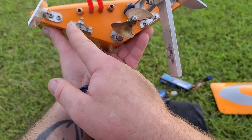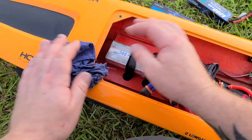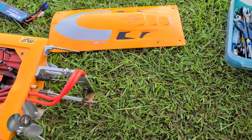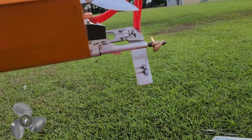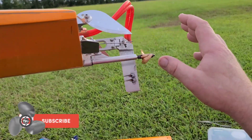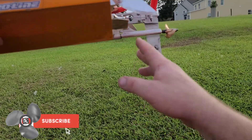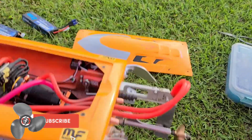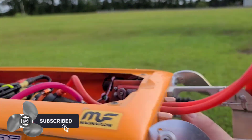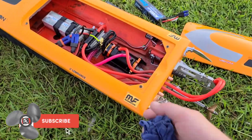With these three components — your strut, your trim tabs, and weight distribution — you can basically get your boat running perfect. Catamarans, a lot of guys are starting to put trim tabs on those too. I've always heard of trim tabs being used on mono hulls. Some guys say you can tune your boat with the strut alone on a mono hull, but I beg to differ. Just adjusting the thrust angle will get your boat to ride better, but it doesn't do the same thing as a trim tab. Hope you guys enjoyed the video — don't forget to like, comment, and subscribe to the channel. Big B with Ironclad RC — we'll see you next time.